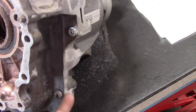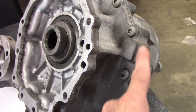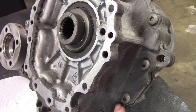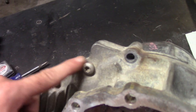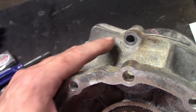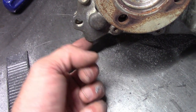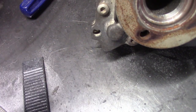Before I get any more aggressive with it I'm going to put it back in the car. For reference, here is what it looked like originally — a stock one with this big ear, these two bolts, and all this extra mass that basically hit the power tunnel so I couldn't center the transmission. Next I'm going to cut this ear off — it's just for splitting the two halves apart. I'll also cut this other ear off for ground clearance; it doesn't do anything functional either.